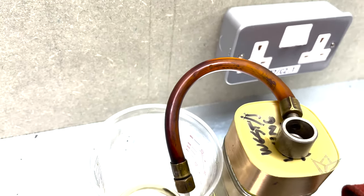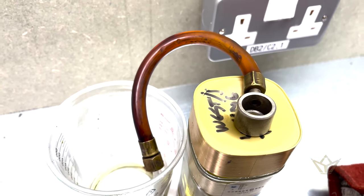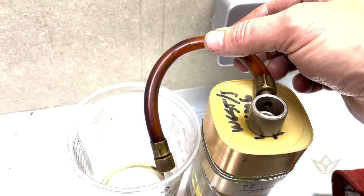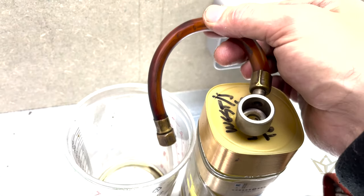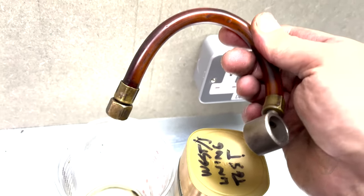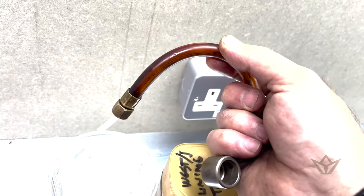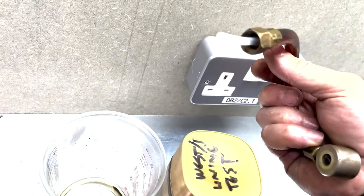Now here's an important note: once you've put the epoxy into the liner, you've got to let it run out. You've got to make sure that it only produces the thinnest lining on the inside surface. That's it. So that's the first thing.